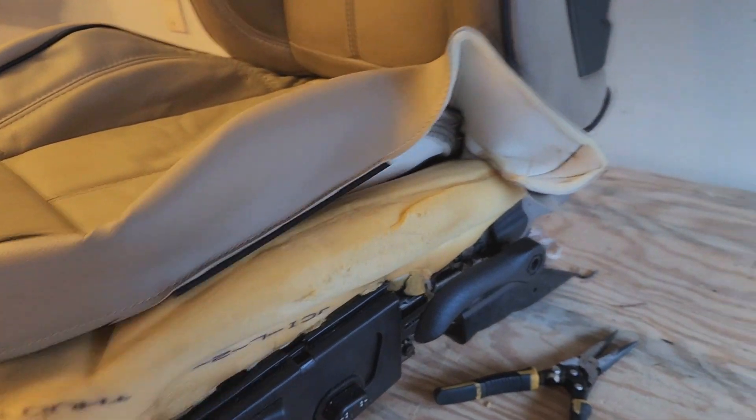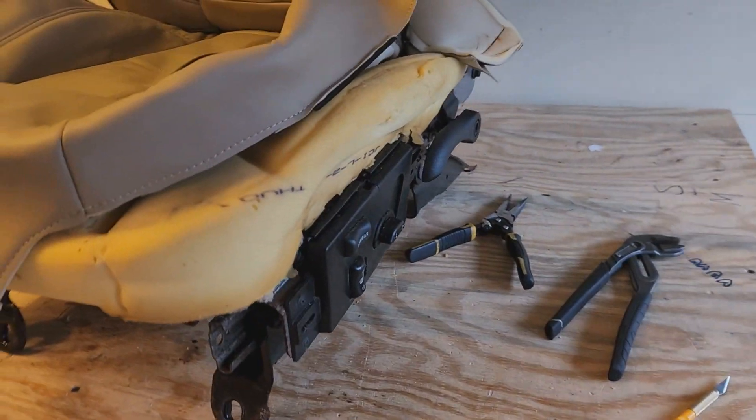All of the metal rings are in — you can see it's holding onto the seat pretty well. This little divot on the top and sides is the reinforcement fabric that goes into the ring, so you can actually use it as a tool to help you line up the seat fabric on top of the foam. Now the easy part: I'm going to get the front bottom section connected underneath to where it's supposed to go. The seat back is loose so you can rock it back and forth to get the seat fabric where it needs to go — just crush the seat down so it has enough slack to plug into its mounting point.